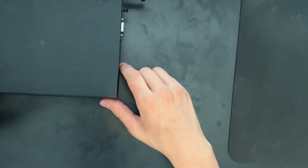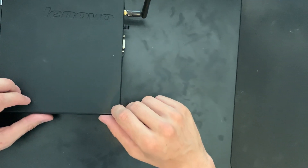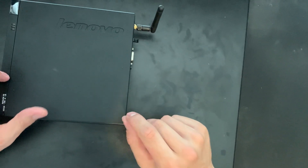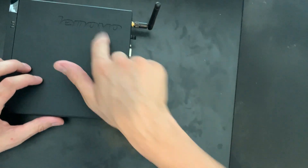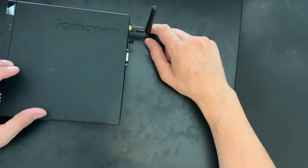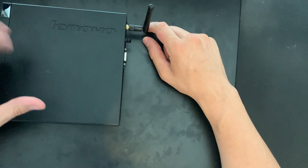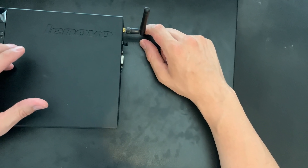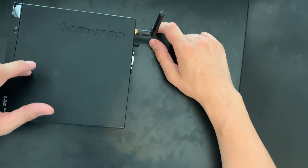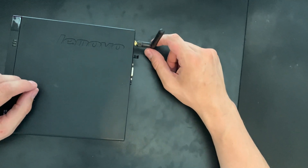Put the antenna back in and we are all done — hopefully it boots without any issue. Just make sure you take your time and be careful, and also make sure you get a processor that is supported. You can find that on Lenovo's website — type in the model number and it should list supported CPUs under the spec sheet. This 4330T is one that actually came with this unit as an option, so I know it should work without issues. I hope you found this video useful — make sure to like and subscribe, leave any questions in the comments, and catch you guys in the next one. Thanks, bye.